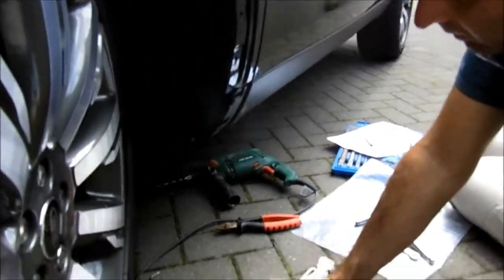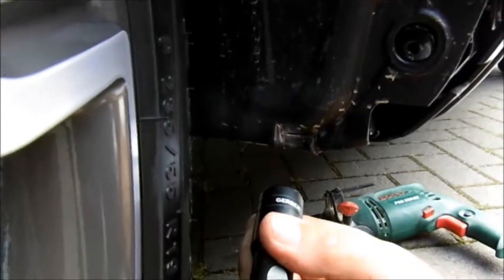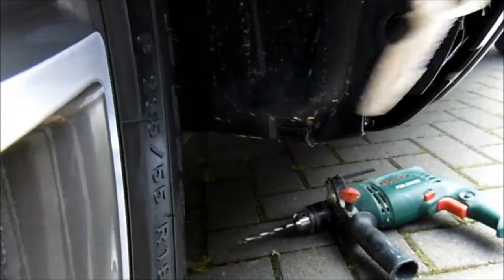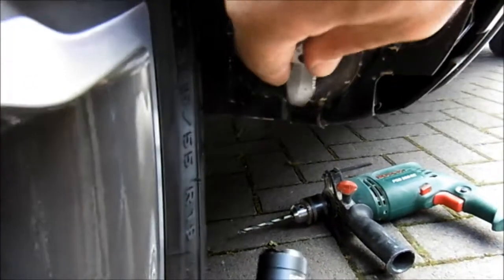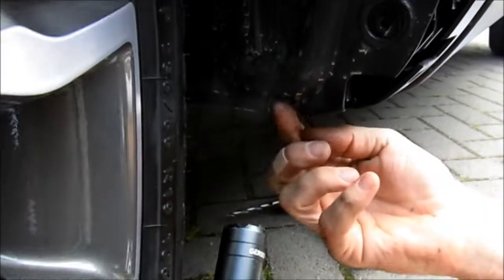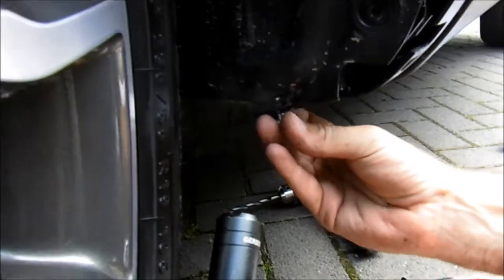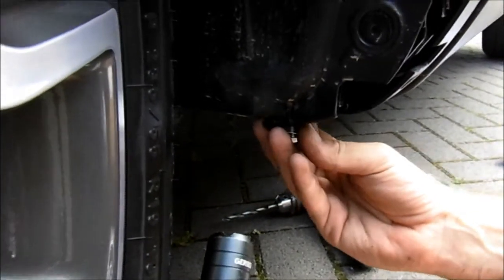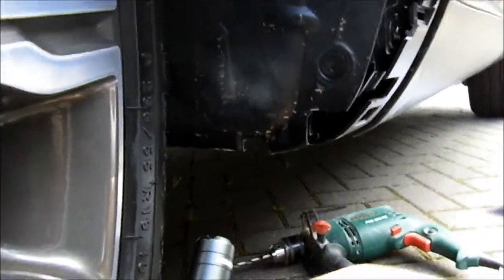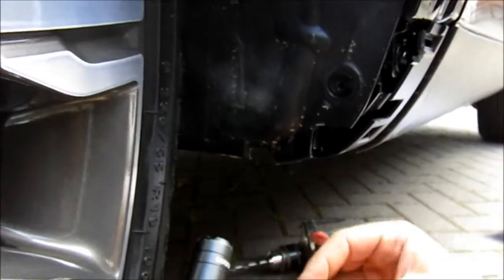I've set it aside over there. Now what you need to do — I'll just put the light on here — is you can see I've pre-cut here a little sliver out. I've just taken my penknife and cut up like that, same there, and then joined the top across there. It doesn't have to be the neatest, but what you'll need to do is trim out that little piece in the recess there. What that will do is, when you have this trim piece holding the bottom of the mud flap, it just allows enough space for that to go in and then the whole trim panel to sit flush when you've done it. Just a small piece like that — if it's not quite right you can always go back and make it a little bit bigger afterwards.